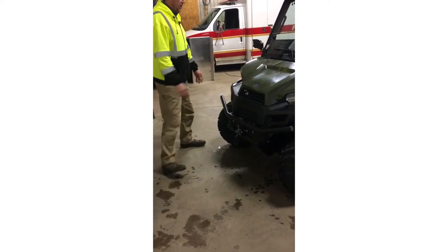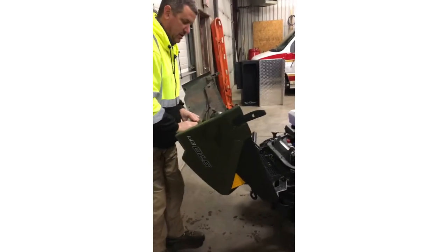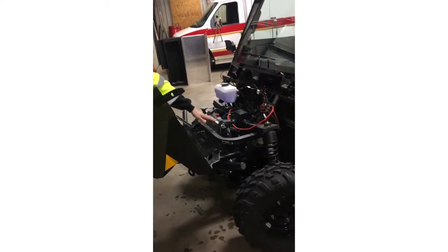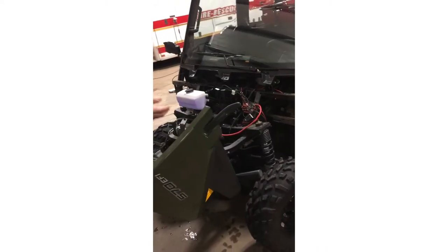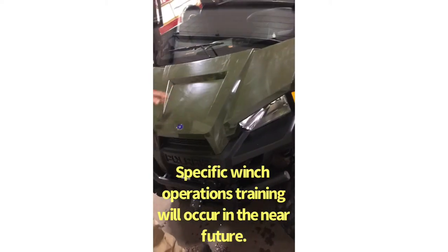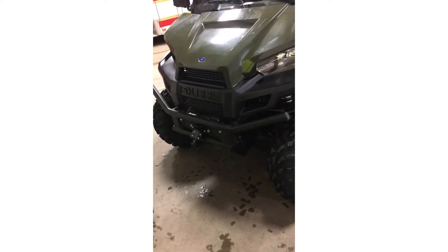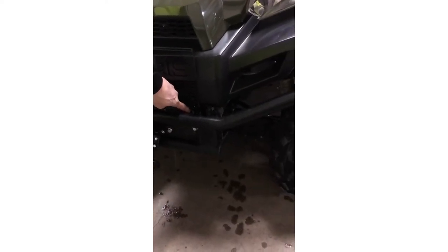This is an overview of the front of our UTV. There are two simple hold-downs, one on either side — grab the hood and pull it towards you. Inside you have access to the radiator, wiper fluid, some electrical harnesses, and suspension adjustment. Underneath is also housed our winch; the winch clutch is on the driver's side. There will be details on using the winch in a later video.